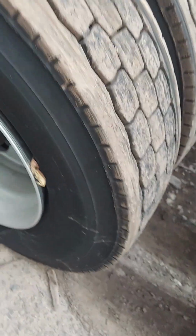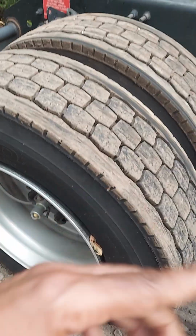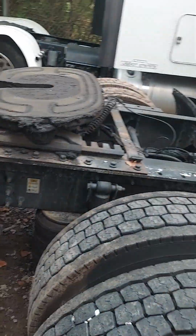Here's what I did. You can see the skid marks on this thing. You can see where it got stuck. You see that mound? You notice that these semi tractors, whenever you got a slope going up and going down, this is the only wheel that turns the truck, but when you put the differentials on, 2 of these come on, 2 of those, and 2 of those come on. But this one doesn't turn. But when you turn off a differential, only one axle turns the entire truck.